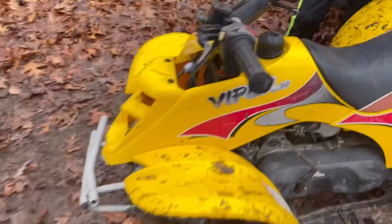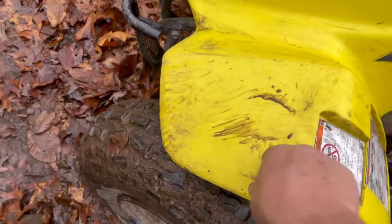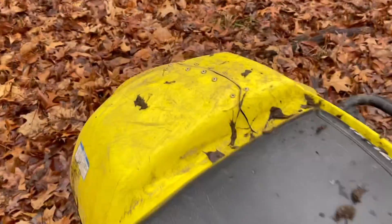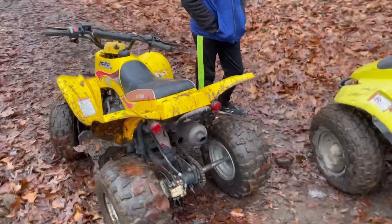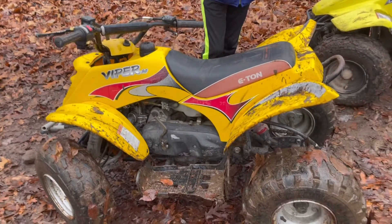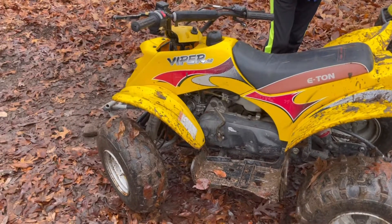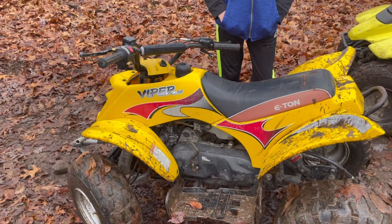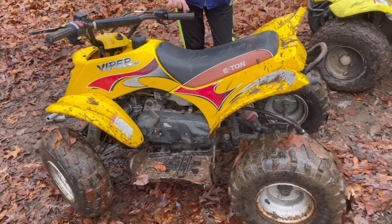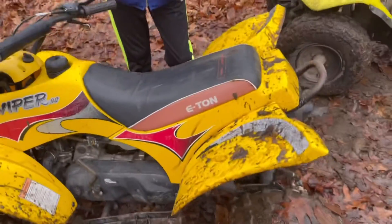The plastics look good, but there's not a lot of flex compared to, like, the Suzuki here, which even after 20 years — I think this thing's a 2003 — has a lot more flex in it. I'm not saying you can't break those; it was broken once, but it was a really hard impact. This is a two-stroke. It is oil-injected, although I like to mix my own gas because I don't trust oil injection. But these things have a lot of nice features for the price — people don't usually want to buy off-brand stuff, and everything is usually built a little bit cheaper, although they have really nice features. This thing has lights, a horn, electric start with a kickstart backup. Kickstart backups are great — no one does it anymore. It has a disc brake in the back compared to drums on the Suzuki.